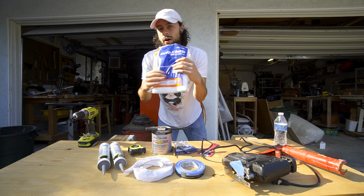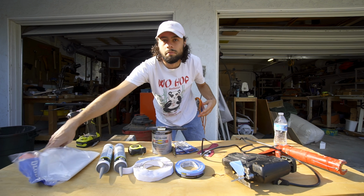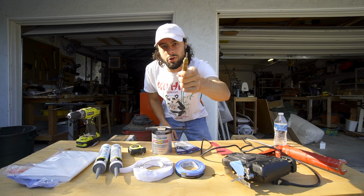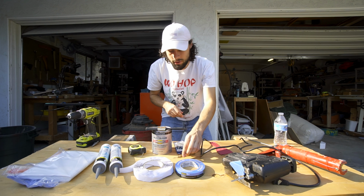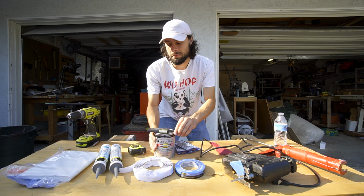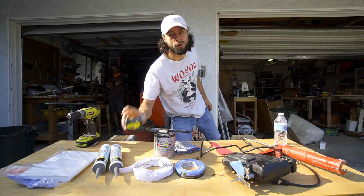We have our cloth that's gonna be here to protect our interior from metal shavings so they don't rust. We have this as an initial score because we're going into metal. So we just kind of pop it in and we have a little mark of where to drill a hole. And we have our rusting paint. So we're gonna paint a little coat after we cut our hole so it doesn't rust. And a tape measure, always need one.